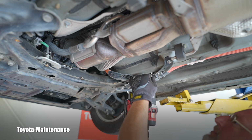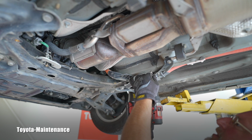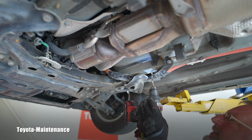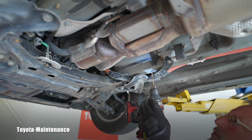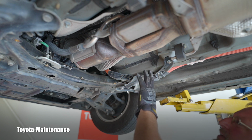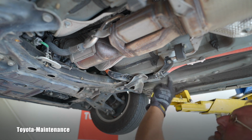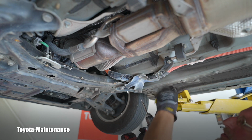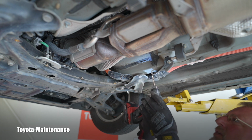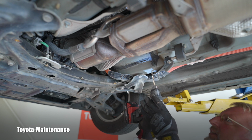So I will grab this high-end drill bit and run it on slow speed. I will start drilling that hole in the body of this Prius. You don't have to be worried. The orange cable, the high voltage cable, is visible right here, so we know we will not end up drilling into that, or the fuel line, or anything like that.